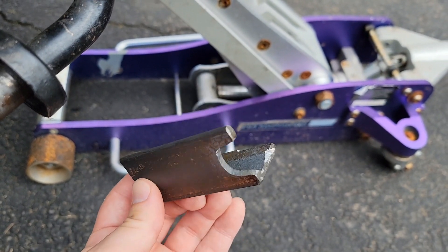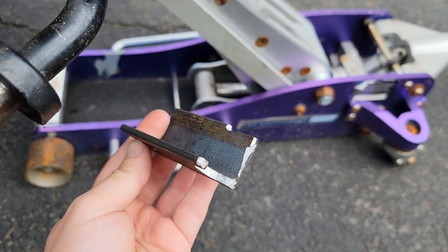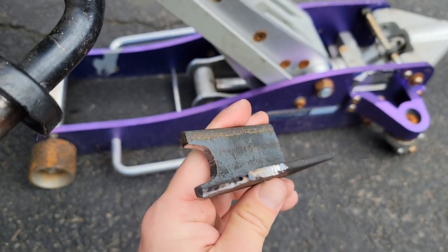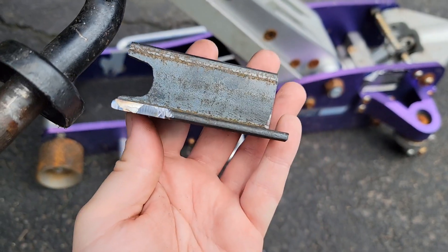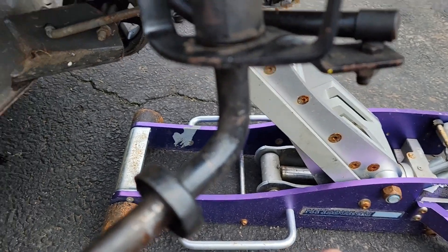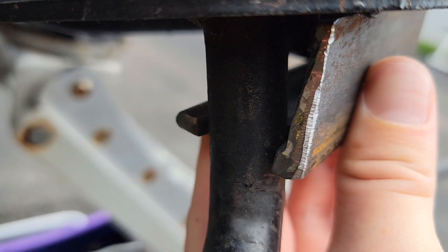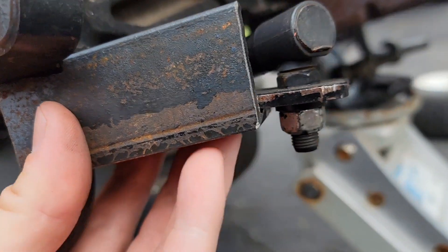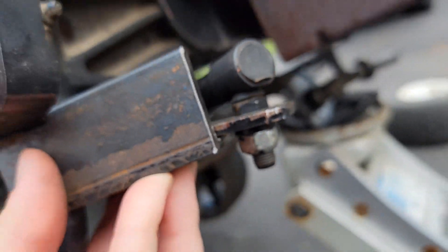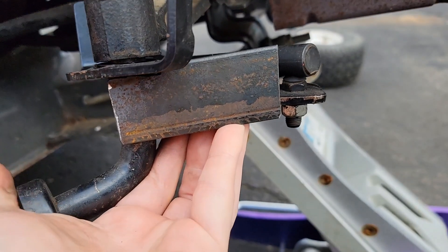I made my notch and that's what it looks like. I did a little more grinding here just to make it sit a little more flush — that's optional, you don't really have to do that. What you need is that hole right there so that this will fit nicely in like that and give you a good surface to weld to. It fits up nice and tight there, then we want that bottom lip flush all the way through next to the tie rod, and we can also do a tack weld up here on top.